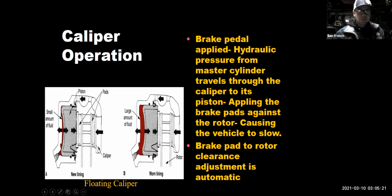Okay. Most cars have these types of brakes where it's a floating or sliding caliper. The difference: calipers that slide are like the old Fords where there's V-ways cut into the caliper and caliper mounting brackets. Most cars float on a couple of pins. So if you watch my video of the Miata brake job, that's a floating caliper. It floats on a couple of pins. I make a big deal to talk about greasing up the caliper slide pins so that they float back and forth.